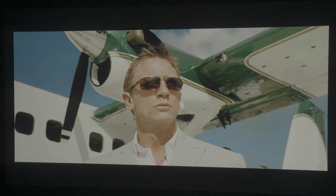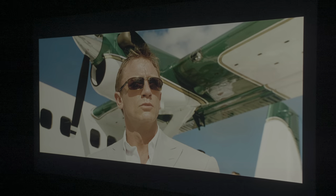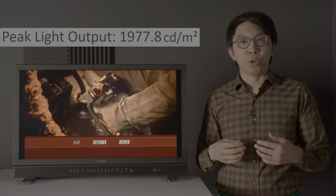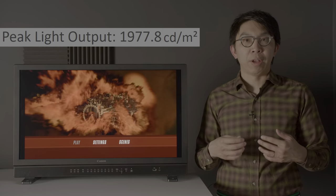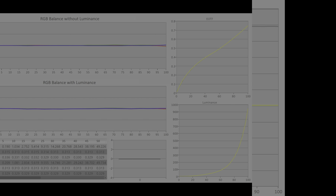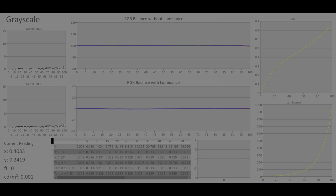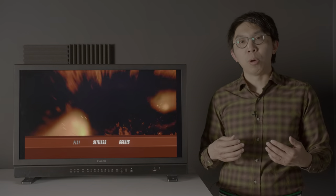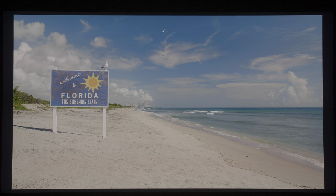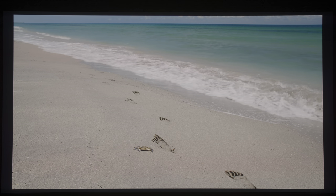The Canon DPV3120 held onto its colour fidelity better off-axis than dual-layer LCDs, but since any blooming artefacts would glow brighter when viewed from an angle, you should try and watch the monitor straight on at all times. For HDR, peak brightness on the 10% window measured close to the spec'd 2000 nits at D65 white point, with impressively accurate tracking for both HDR10 PQ and Hybrid Log-Gamma EOTF out of the box. Because the Canon was able to sustain almost 2000 nits of full-field peak brightness, bright HDR scenes just popped off the screen, outperforming any other display we've tested to date.